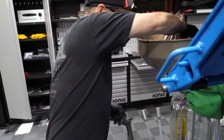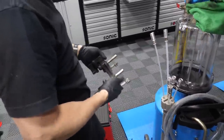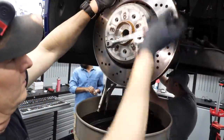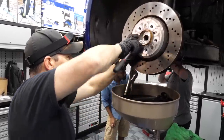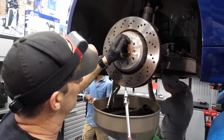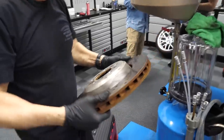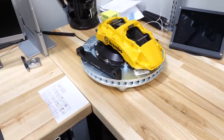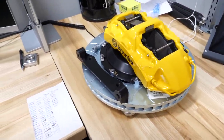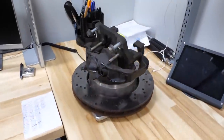Let's weigh it and see how much it is. I think the stock ones are aluminum but this bracket feels heavy. We'll put those on the scale. Let's paint this first. All right, so the front six-piston Brembo without the lines is 38 pounds 11 ounces — that's going to be a lot heavier than stock, but it's also much bigger. Here's the OE, and our pads are worn — 36 pounds 10 ounces. So two pounds one ounce difference.